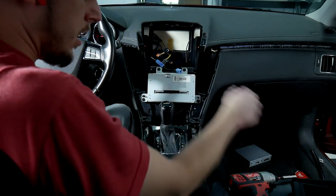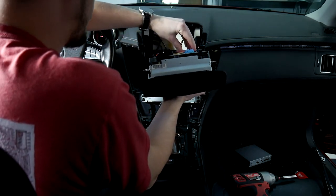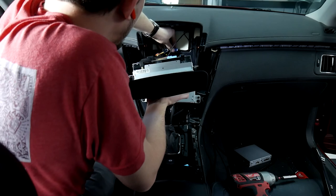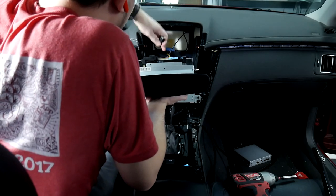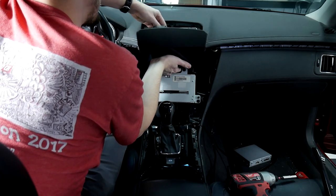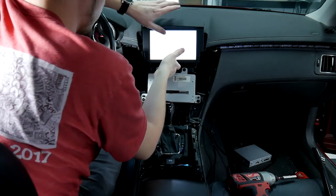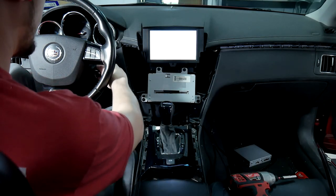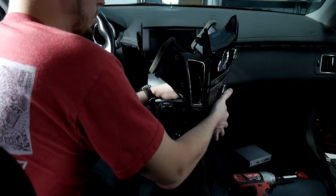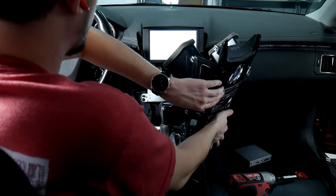Just going to make sure it's off to the side. Now we're going to take our display, plug in the GDMF first. This cable right here we don't want bent, so I'm just going to stuff it right here so it's not in the way. Slide the display in, plug in the two other plugs. In this case the radio went back down — not good. So we're going to turn the vehicle off and plug back in the bezel. Once the bezel's back in, we'll turn it on and you'll be able to open it back up. The display is white right now — that's perfectly fine, as we don't have the video cable hooked up to the V-Line yet, so it just doesn't have any signal; it's not broken.